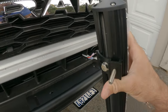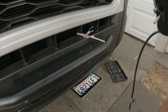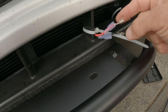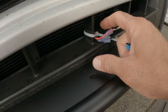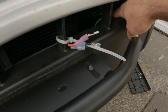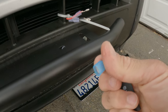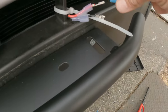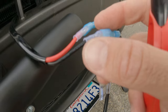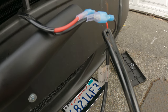I've got this bolt tightened down where it needs to be. Before I mount this, I'll go ahead and make the electrical connection first — that'll give me a little more room to work with. We'll just connect the positive and negative of the light bar to the wire we ran earlier. I'm going to remove this zip tie and pull the wire back through so it's hidden. All the zip ties are loose right now until I make the final connection, then I'll cinch them down and cut off the excess. The kit comes with connectors to plug in. I have some additional heat shrink and electric tape to protect the connection. When you make these connections, push the rubber into each other and use a lighter to melt the shrink wrap — it should give a nice watertight seal.